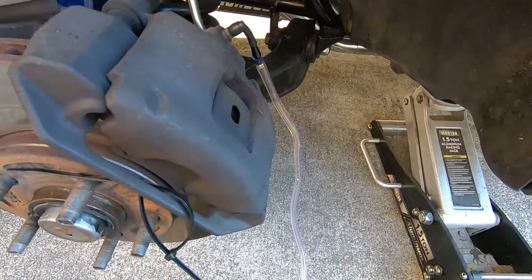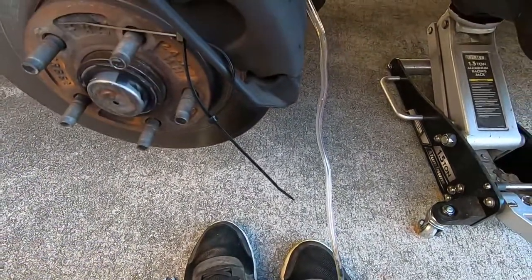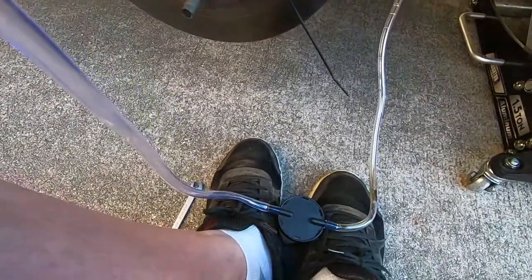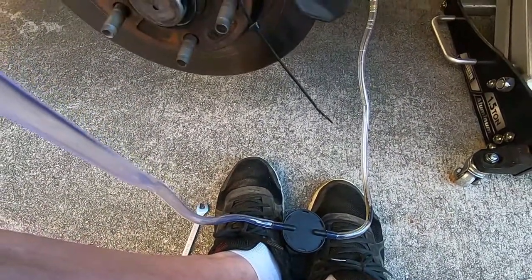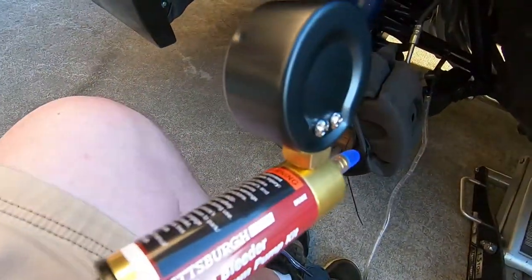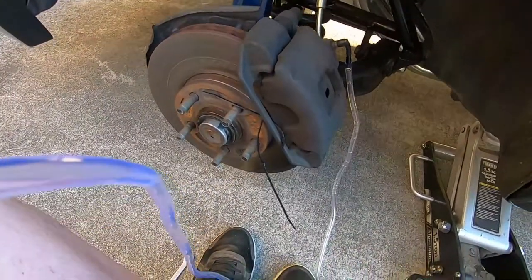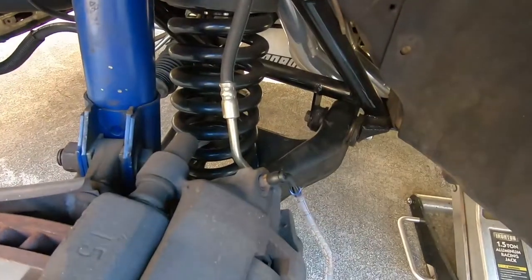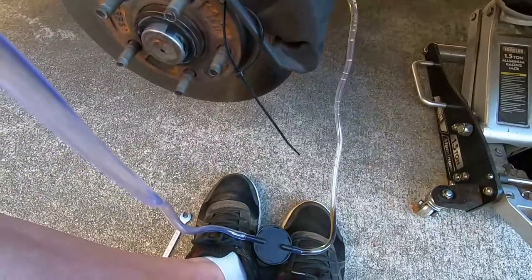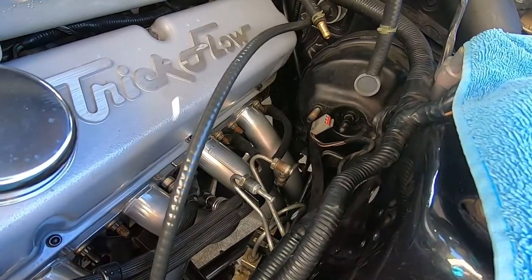As you can see, it's coming out into the cup. One thing to remember with this kit: you don't want any brake fluid to leave that cup and go toward the pump. If it gets into the pump it will ruin the seals and ruin your pump. Just crack the bleeder screw and start pumping away until the cup gets full, then drain the cup and keep going.